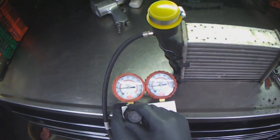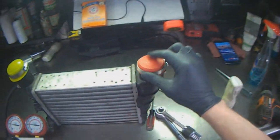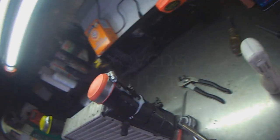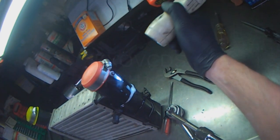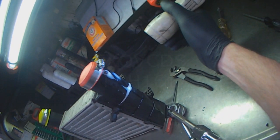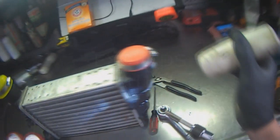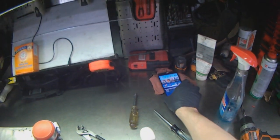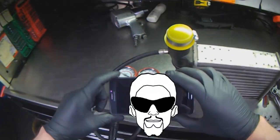Let's go up to 20 PSI and see what happens. You can see the bulging here at 20 PSI. Let's watch the rate of increase in bubbles — yes, it's bubbling a little bit quicker with more PSI. We're actually creeping up to 25 PSI. Again, this is nothing that I would be worried about or consider a leak. I would still not be concerned about this at 25 PSI.